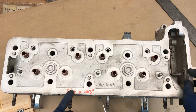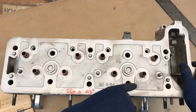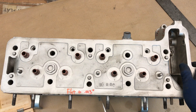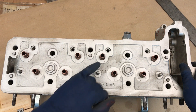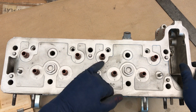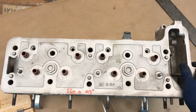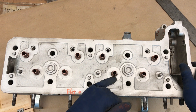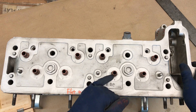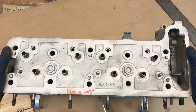Here's your production date — it looks like 1959, though that doesn't mean much. People often want to know what these numbers are here. There's a 3, a 2, and a 2 — these represent the oversizes that the factory used when selecting valve guides to install on the cylinder head. You don't need to worry about that when installing new guides.